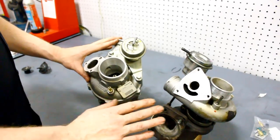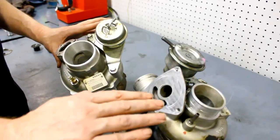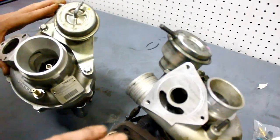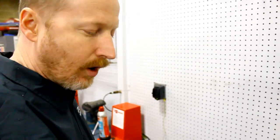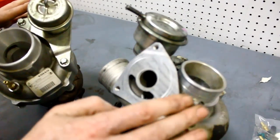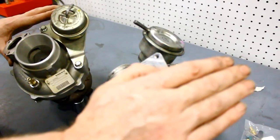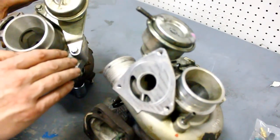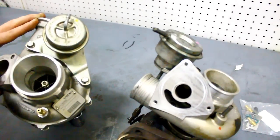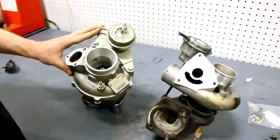On either of these designs, the bypass valve is supposed to maintain your boost target. When you hit shift points or there's an ebb or flow in your boost, the bypass valve should open, allow your charge air pressure to go past back into your intake, then close as soon as you reach your target boost — so you don't end up with boost spiking too high at a shift point, pulling back too far, and then taking a moment to creep back up to your target. The more leakage you have, the more that spike goes up, pulls back too far, and takes time to return to target.